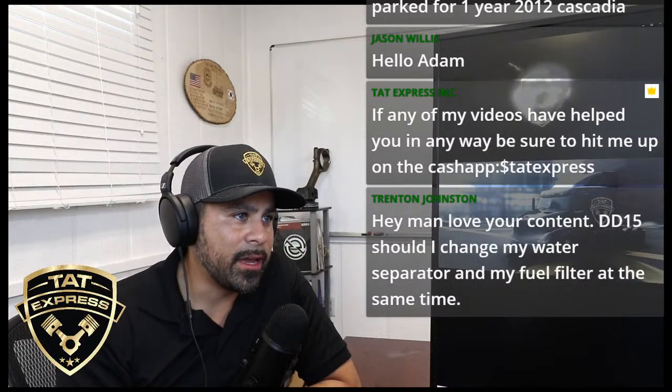Good morning. Can I change only one head gasket on my Mercedes 400 leaking coolant? You can. It's going to be a lot of work to get down to that one head. It's going to be a lot of cleaning, and you can see how it lasts. Those type of engines right there, I can understand how it's tough. It's tough to make that decision. I see it in the bigger engines. I don't see it too much on the smaller engines, but you can try out that one cylinder head and see what she does.